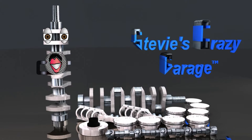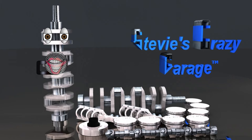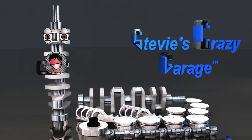The first reason is that flat plane crankshafts are very light — about 35 pounds. A standard racing crankshaft for a small block V8 weighs about 45 pounds. This allows the lightweight crankshaft to turn at a very high RPM.